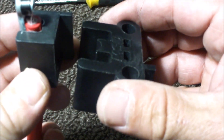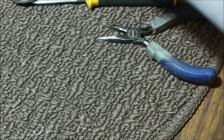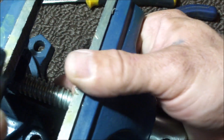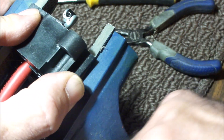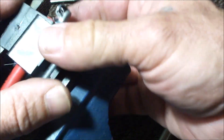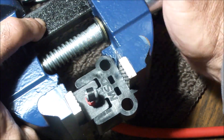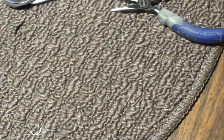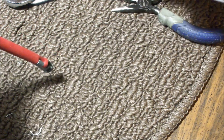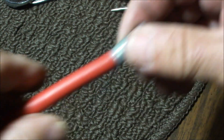Let's get the other half of the die in place. Notice the two tabs — those two tabs are designed to sit on the lips of the vise. So let's bring the vise back into play. I'll tighten down on this and readjust to make sure it sits flush as much as possible. The manual that comes with this mini crimp strip tool does say to be careful not to over-tighten, as that could damage the components. That looks like we got a pretty solid crimp.